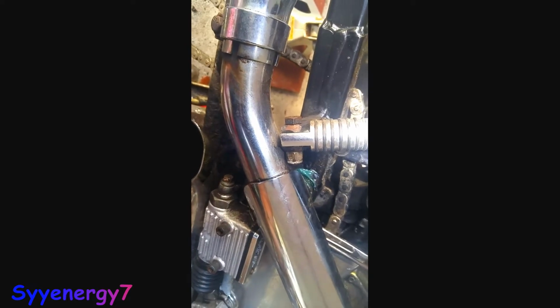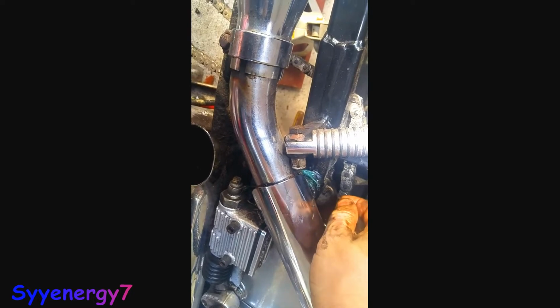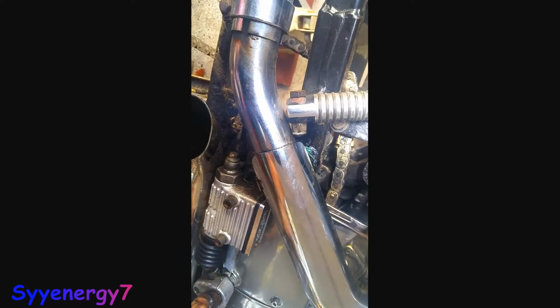That would make it a lot easier, because if you force the grease in here, it's going to go all through to the second bearing too. I know there's a snap ring in there, but you're still going to get the grease in there, and that's the whole thing, is just keep the damn water out.